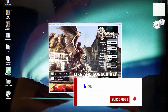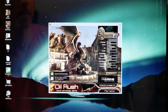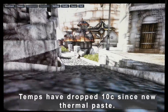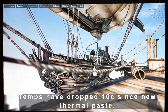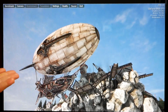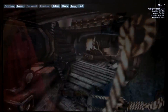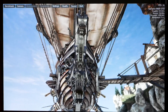Setting up to monitor temps now. GPU temps are running around 72 Celsius — that's roughly a 10 degree Celsius improvement from the reapplication and cleaning with new thermal paste. Not too terrible — I'll take that as a win. So clean and reapply new thermal paste to your video card, everyone, especially if it's old.